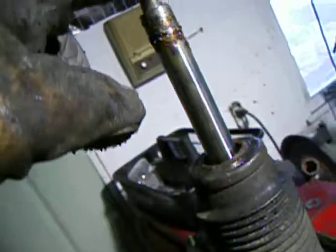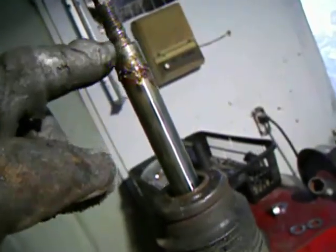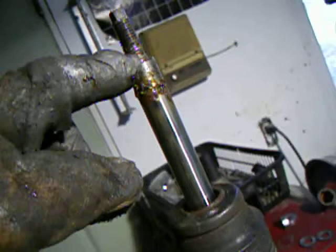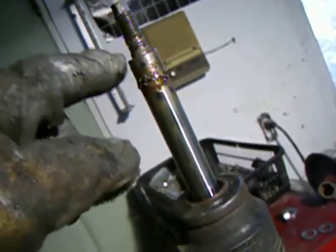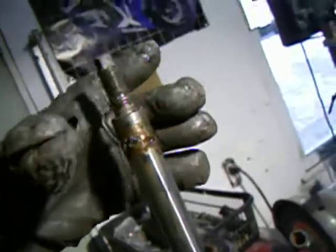When the strut mounts go bad, if you look inside the strut mount, you can see the rubber deteriorating. One of the stupid things I've got here is, this is the new strut, 10 millimeter bolt on top, but you can see the threads here do not go, well, I don't know if you can see or not, but trust me, they don't go all the way down to where the shaft bottoms out. The threads go about 80% of the way down, and then there's a non-threaded, larger diameter piece right above where the top of the shaft is. That's where the strut mount sits over.